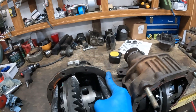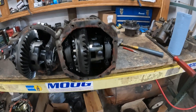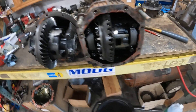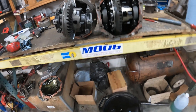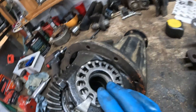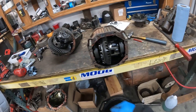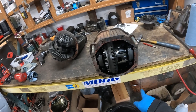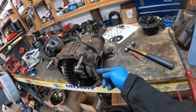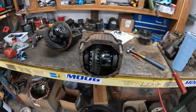Here's a quick look at the actual differential carrier. You can see the cases — this one is a little bit wider, but they look generally similar and are assembled very similarly as well. Good practice when tearing down any diff is to make some sort of match mark with the cap so you don't get it mixed up. These are cast and machined so they're side-specific. I'm going to put a punch mark here rather than on the sealing surface, and then pull the cap bolts off and pull the diff out of there.